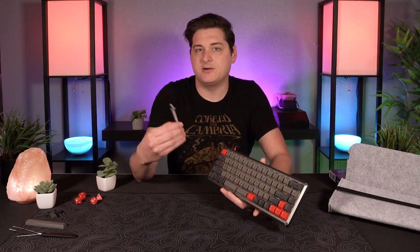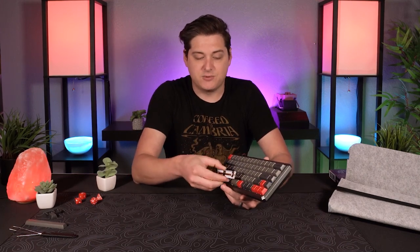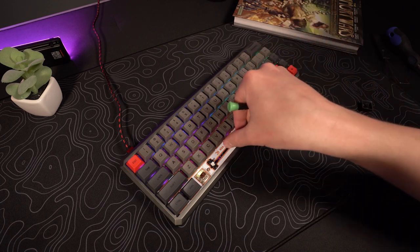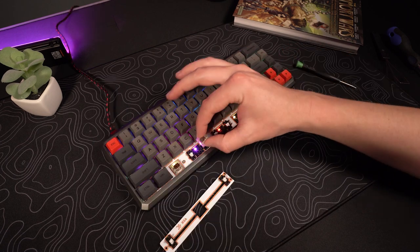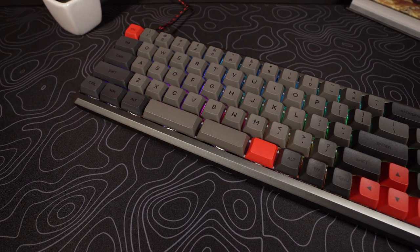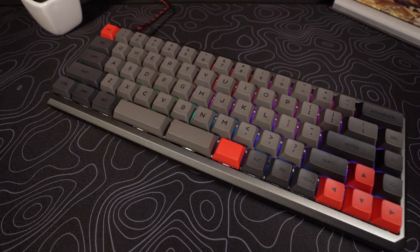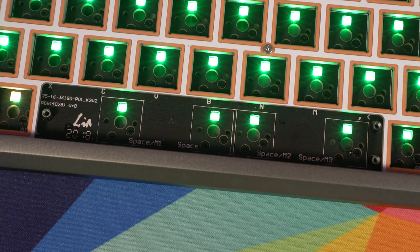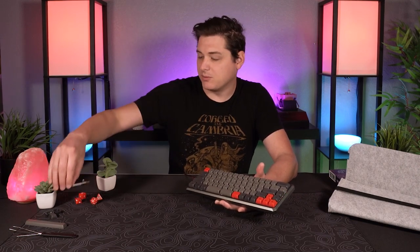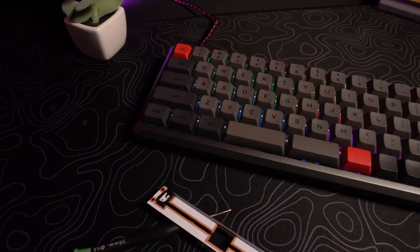One of the coolest things about this keyboard is that it comes with an interchangeable spacebar module. It'll come stock with just a regular size spacebar, but you just pop the keycap off, unscrew the plate mount piece, and because it is hot-swappable, pop the switches out as well, then screw in the new spacebar module. It basically breaks up the spacebar into three buttons, giving you two more function keys so you can further customize the keyboard and have more options for macros. Not only are there other switch sockets in the PCB when you swap out the modules, but there are also plenty of LEDs in there, so you don't lose any functionality or lighting when you swap out that module. The stabilizers will still be the same modded, comfortable, nice stabilizers.